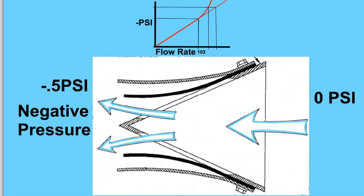So when you do that you're just creating an additional flow resistance that shouldn't be there. I'm going to try to explain why an excessive pressure loss across the reed valve is unproductive or negative in its effects. The flow rate is linear in response to the pressure difference or the vacuum that the crankcase has, up to a point — up to 102 meters per second. Above that, instead of continuing on with a linear response you get a nonlinear response, so that when you apply this much vacuum you would expect this much flow rate but you don't get that — you get this flow rate. So this area out here is what you want to avoid because it gives you less performance.